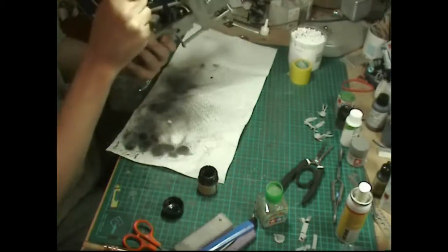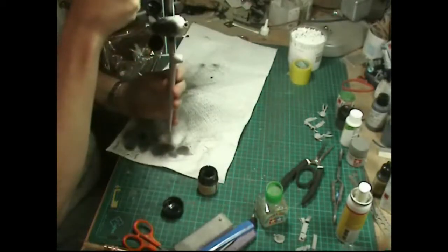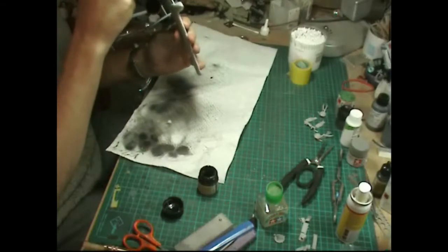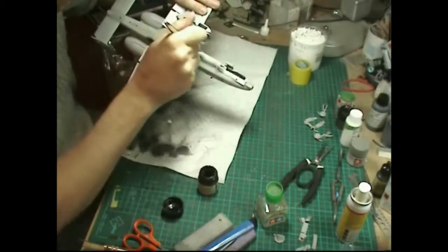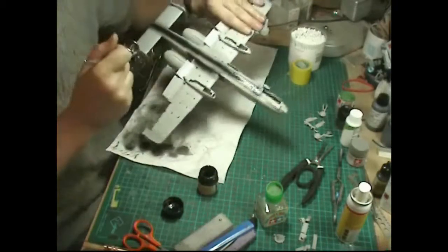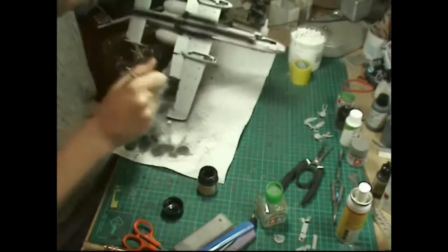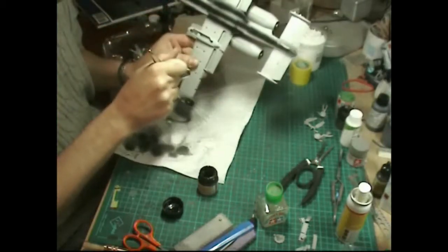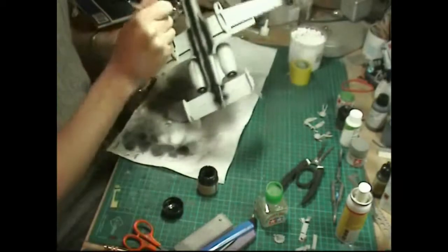The fuel filler door area - I wanted to see what that joint looked like, so we're spraying that in there as well. The fan blades are a bit of an awkward angle to get to - I'm going to make a paper mask for them. On the underside we'll check those centre seam areas. One thing I've noticed is there seems to be quite a lot of release agent left on the parts, because the paint is bubbling up already at neat application, which in theory it shouldn't be doing.